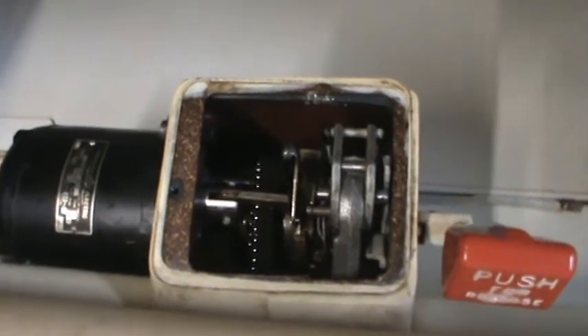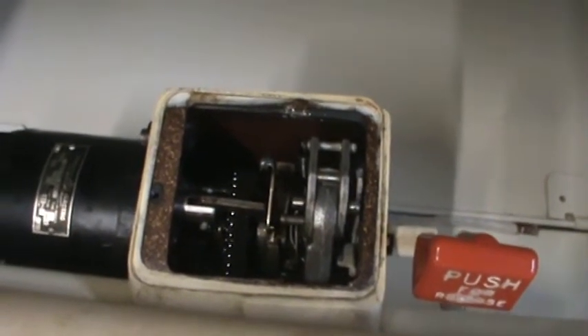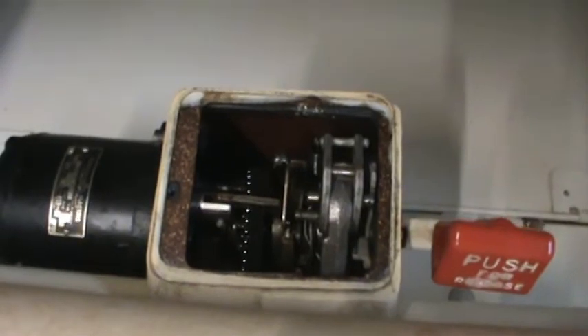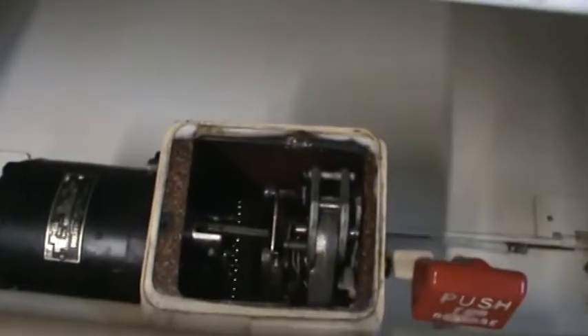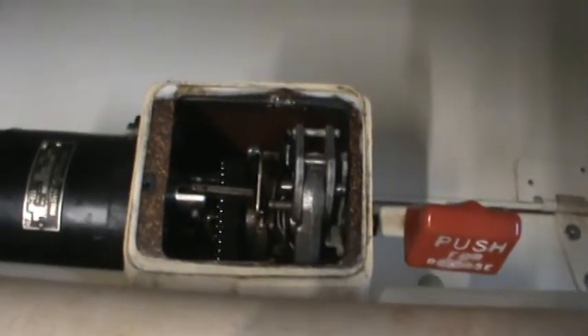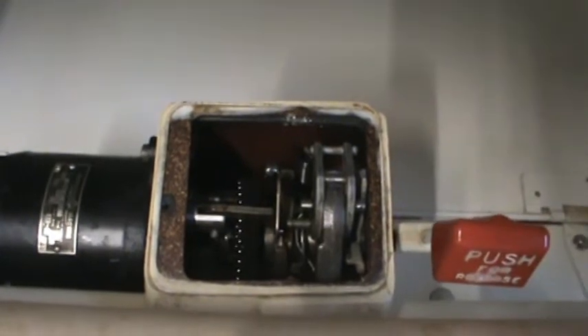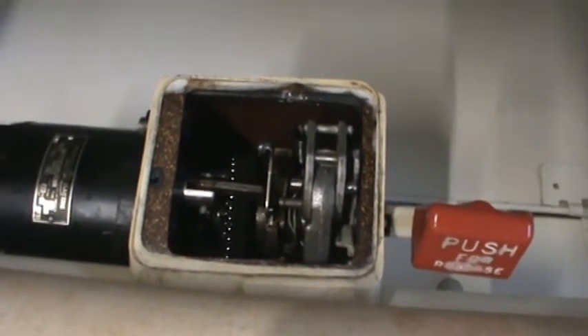Oil changes are simple. All you have to do is drain it by pulling the plug and putting the right container under the hole, wait until everything's out, put a little paper towel under after removing the container since it will drip a bit, then put the plug back in. Add five ounces of whatever oil you'd like — I used 10W-40, though SAE 50 and 3-in-1 are also recommended. Just pour it right over the top; it goes in because the parts sit in an oil sump. Do not overfill — five ounces should be sufficient. There are friction parts including a clutch, and if you over-oil it your clutch won't grip anymore, and you might get the roller going up and down but not turning.